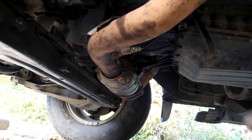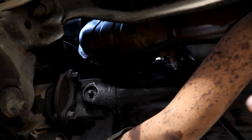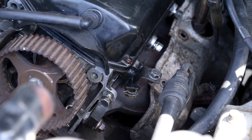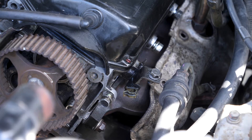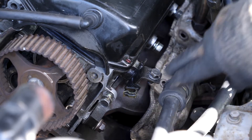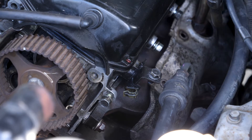To get the exhaust manifold on, I had to take this section of pipe and push it up from underneath, along with that cat right there. I got the exhaust manifold back on the posts — I enlisted the help of my lovely wife. While I held it below and supported it, I had her thread on the first nut. Now I can go about threading the rest.